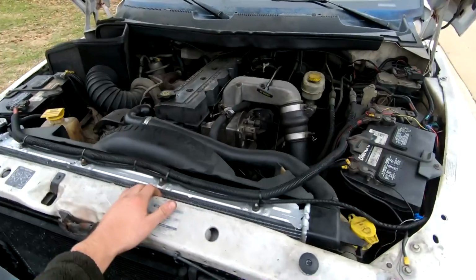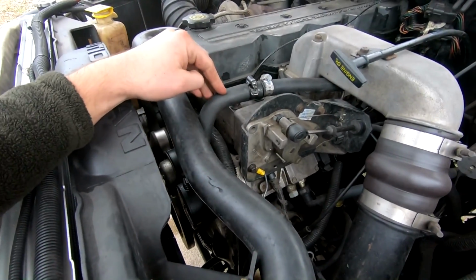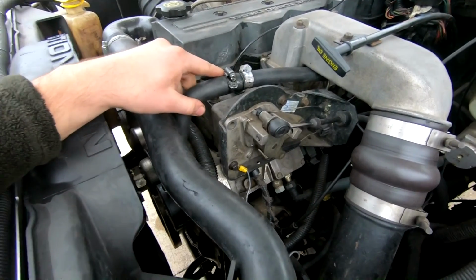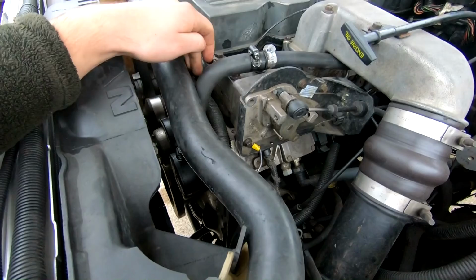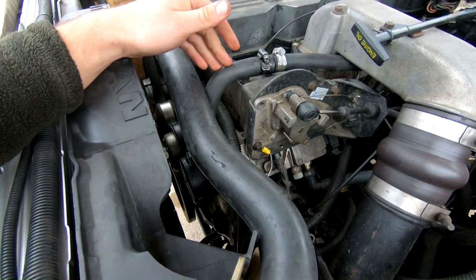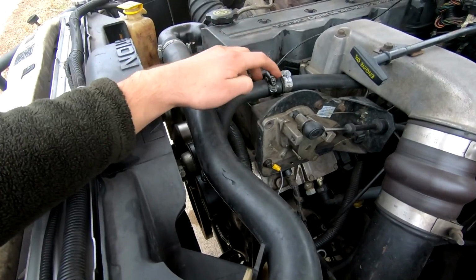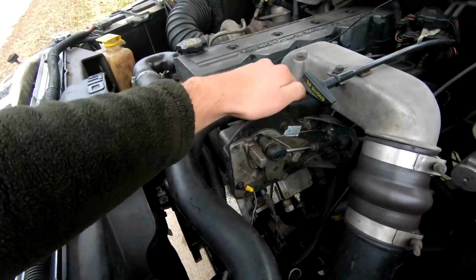All right, so I figured out how I want to run the crankcase vent. There's actually some leftover 3/4 inch heater hose that I had laying around. If you guys follow for the Mustang, you'll know I used it for my intercooler, and it actually happens to fit perfectly. So there's a 90 that was from the old intercooler, but any 90 heater hose, or even not, you can just buy the actual 90-degree elbows. But anyway, from right there, it comes up, runs underneath here.